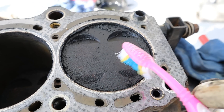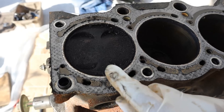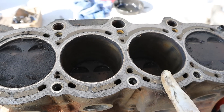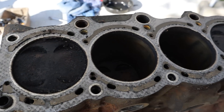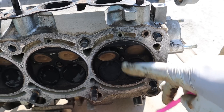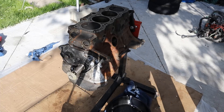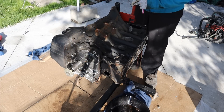Let's go ahead and remove the head. Taking a look at the top of the cylinder head, you can see things are looking really crusty with a lot of carbon in here. You can also see that these engines still use the composite style gasket — not a multi-layer steel gasket — which makes it pretty difficult to clean off during a head job. Down underneath the head things look normal with the exception of this valve on the exhaust side of cylinder number 4 which is stuck in the down position. Let's turn this engine over to see if there's any mess.